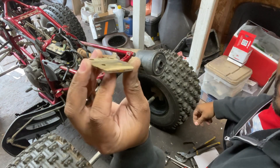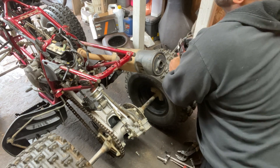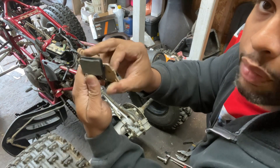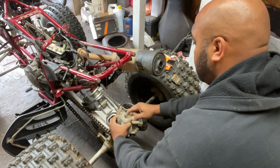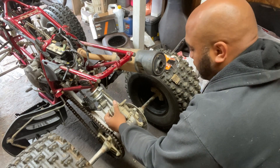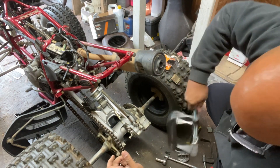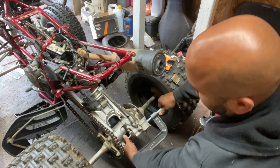From looking at it, these brake pads are non-existent — there's nothing there at all. We're going to do a quick comparison to the ones received in the mail to show that brakes are supposed to have pads on them, and these definitely don't. The brake piston is going to have to go over, and I'm going to use a c-clamp to do that — that's standard for most people who work on any kind of brakes.